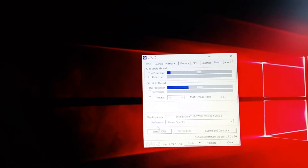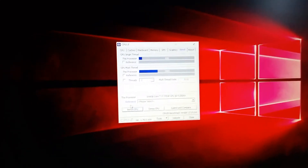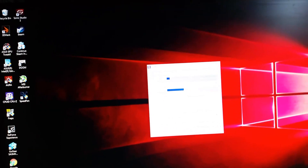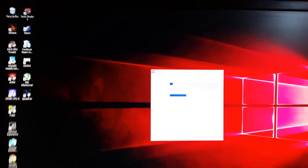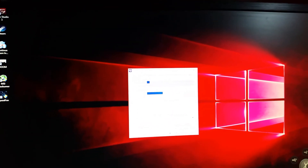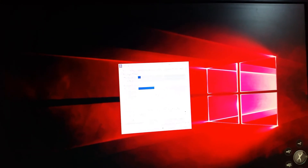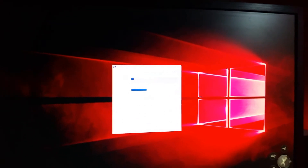Right — so I've got a score of 2685 on the multi-core and 525 on the single core. So yes, it works — you can mix and match DDR4 RAM, as long as the timings are the same or very close and you manually set them. I'd say you have to manually set them to 2133MHz and don't pick auto. When I tried auto the computer wouldn't boot — I kept getting the CC debug code — it just wouldn't go.